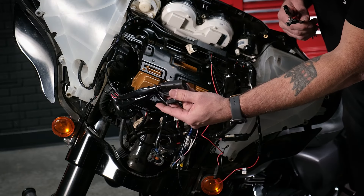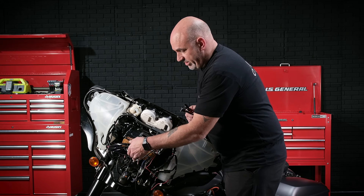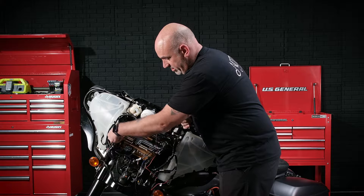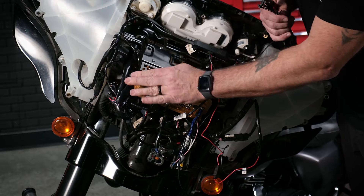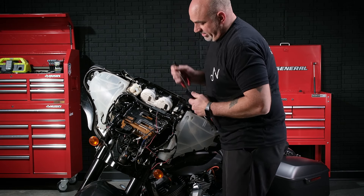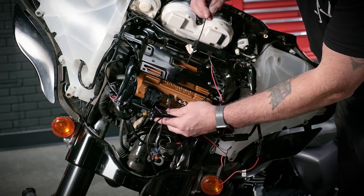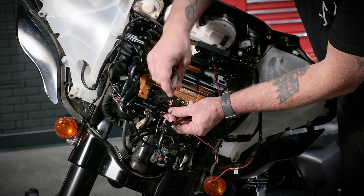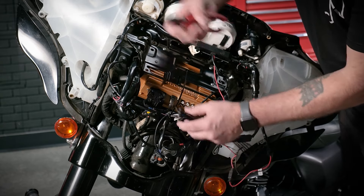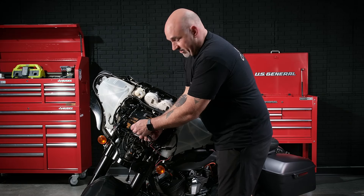In the case of ours, we only have front speakers, so we will not use any of the additional plugs that were behind our head unit. We'll go ahead and pack those away between the pocket and the radio. And then we have some of the wiring here that we're just not going to use, so we're going to zip-tie that out of the way. In your case, you may or may not use it — everybody's a little bit different.